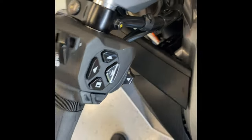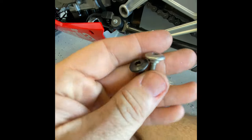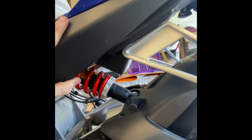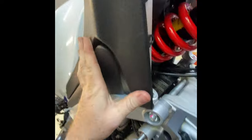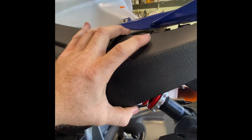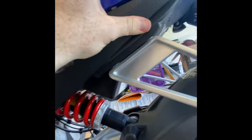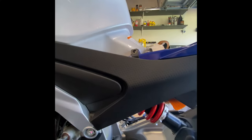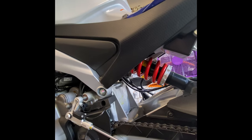For this inner piece I like to line up my screw hole here first and screw that one in, then do the other two. For the side piece, you've got two bolts — both four-millimeter. The black one goes on top, the shiny one goes on the bottom. Take your piece, there are two clips here — slide those up in there and then slide it forward. You'll see your bolt holes line up. Make sure that clip engages, otherwise back it out and try again — you've got to get that clip up there first, then keep those back and push up in there, then slide it forward and put your two bolts in.